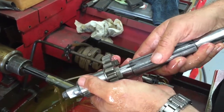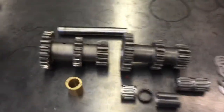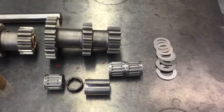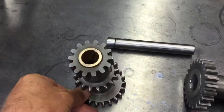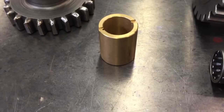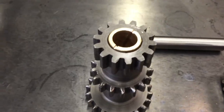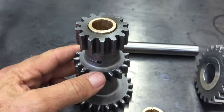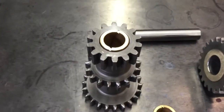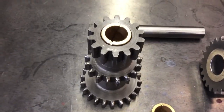Clearance is really important here. There are two different setups for the cluster gear — you can either go with the stock bushing setup or our upgrade which has roller bearings. The stock bronze bushings have a helical groove in there. A lot of people think that the helical groove is to do with oil pumping through the oil holes, but it actually doesn't — it just doesn't allow for edge loading when it's running on its countershaft. So it just avoids the high edge loading — that's actually the reason why the helical oil groove is in there.